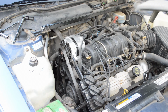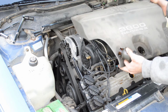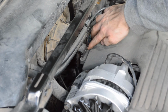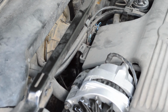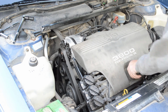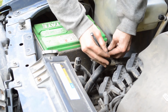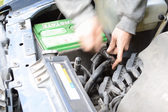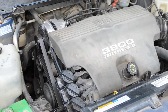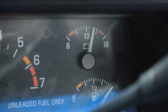I can go ahead and put the plastic cover back over the engine. Note how the back part of this cover hooks under this metal hook here. And finally, I can hook up the battery again with that 8 millimeter socket. And it is looking good. Well, everything checks out, so we are done.